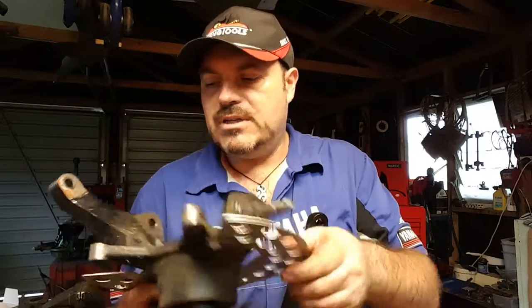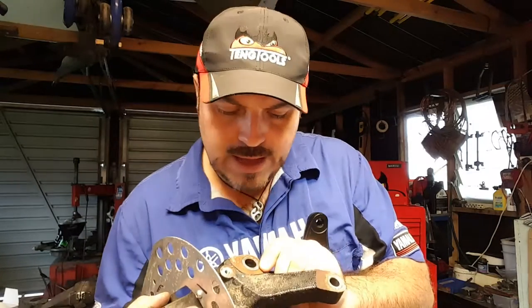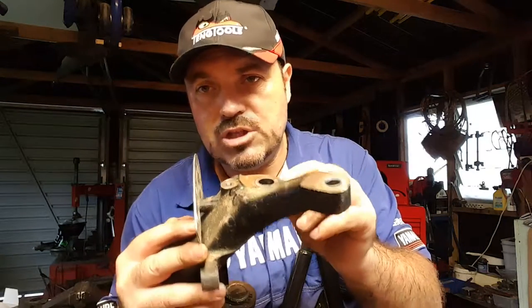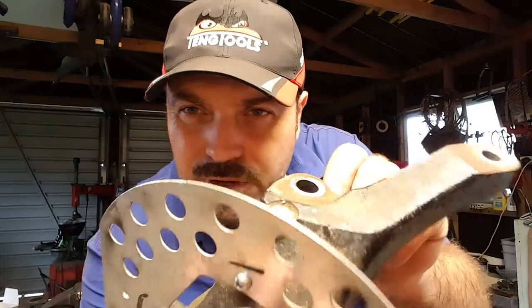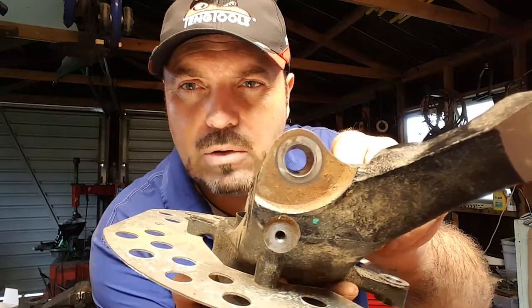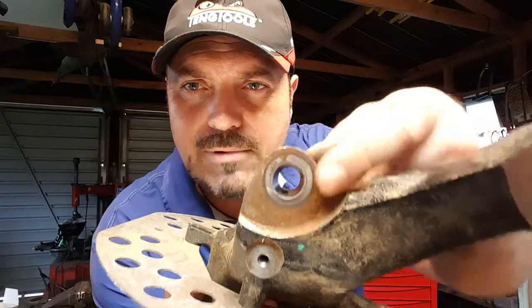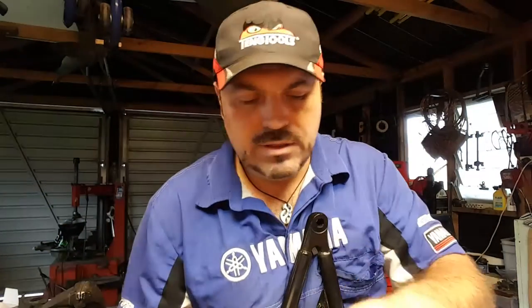We're already going to change the knuckle joint. We know the knuckle joint's been damaged. That was highlighted in the first video during disassembly and diagnostics. We found that this hole here, which is where the top ball joint fits, has been very badly damaged. I don't know if you can see that on the video or not, but it is actually distorted. There's some pretty serious damage to that hole. Maybe you can see that, it's not ideally round. We've got a raised part down here now. And the ball joint itself, the tapered part of the ball joint, the stud, was loose in that hole. That was what was giving us all that movement on the wheel. So we're going to replace the knuckle joint.